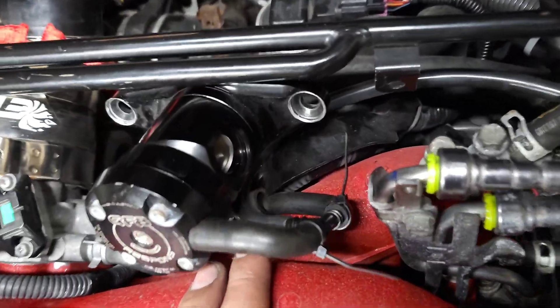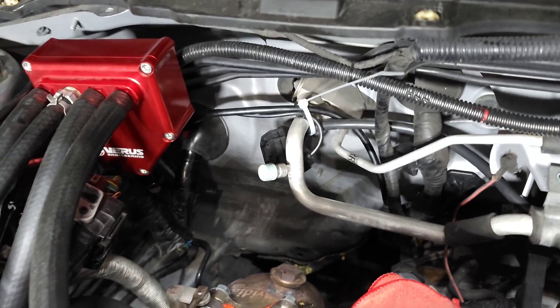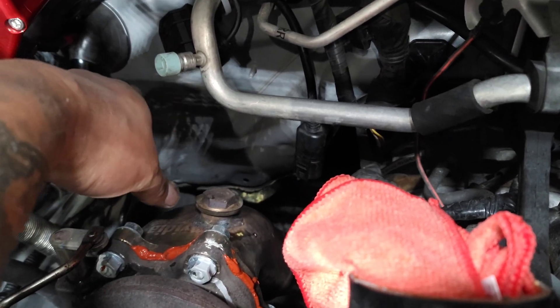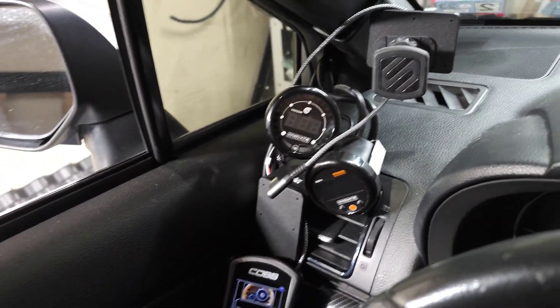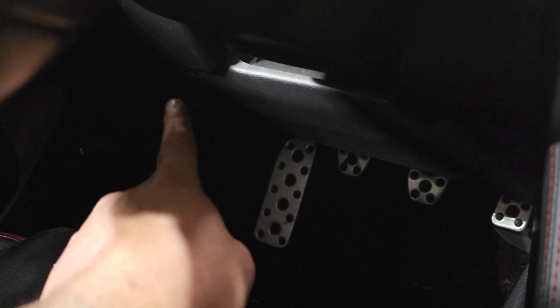Alright, so I have the boost reference right here and it's running underneath, following the AC line all the way to the top and then headed towards right here. I have it zip-tied off at the sensor right there and it's going to be connected right there — so this is going to be nice. I just got done running the wires for the boost gauge and the AFR. Had it running from here, went along the side, underneath all the way through, underneath the steering column, routed all the way up, connected to the fuse box right here, then grounded, powered it, and sent it up.